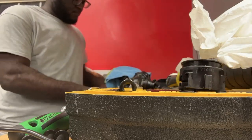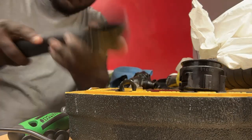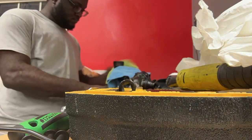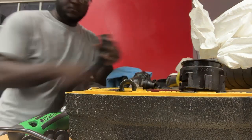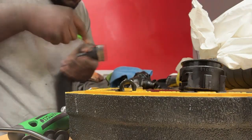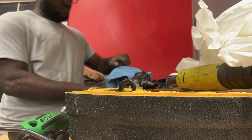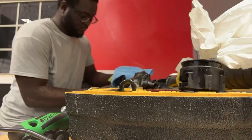So this is what I had to do to fix my problem of not having the part. As you can see, it's dark outside, probably about 12 o'clock at night. I used the vise clamp to squeeze off the plastic, then put each end of the metal one into it and tightened it down with the hose clamp. Make sure it's really tight, but not so tight that it's eating into the rubber. Then I lined it up with the T-pipe that goes to the heat management module, made sure everything was positioned right, and that was pretty much it.